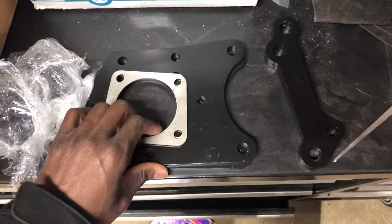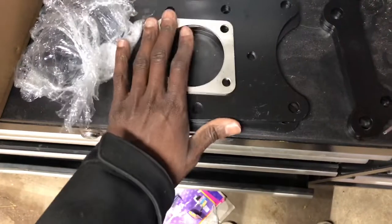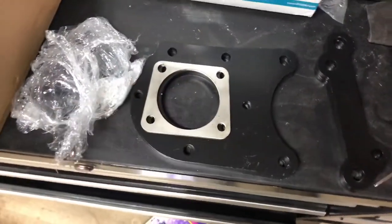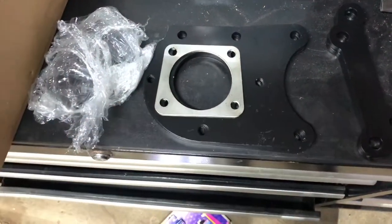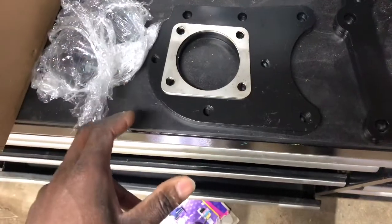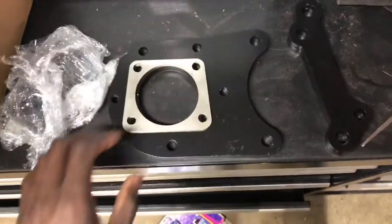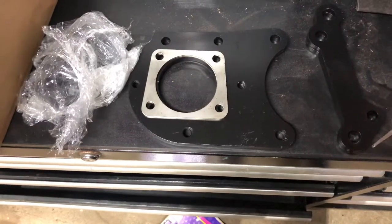I should have everything I need for the rear. The next thing I need to figure out is whether the studs I put in are long enough. The studs I'm running now are M14 by 1 and a half — those are from the new Camaros — versus the Chevelle's original studs which are way smaller. I had to switch those up for the Range Rover because of the rims I was running. I had the rims off a Range Rover and they had the Range Rover bolt pattern and a different lug.